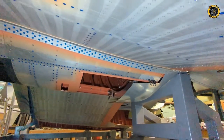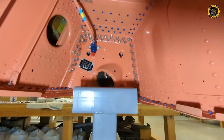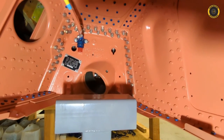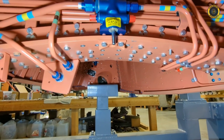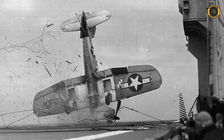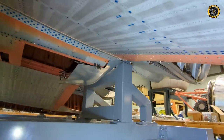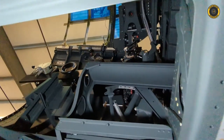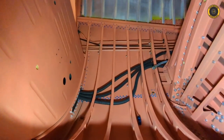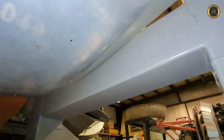Now we're underneath the Corsair. There's the center section of the fuselage and here's the bent wing part — the bent wing bird as the Corsair is known. There's your main landing gear mount with that intricate angle-swiveling mechanism that gives the Corsair its short, stout landing gear for carrier operations by bending the wing like this. Intricate design — they were able to build a gear stout enough to handle carrier operations while clearing the some 13-foot diameter propeller. Looking up into the cockpit from underneath, just forward of the cockpit is the fuel bay — about 230 gallons or so of fuel in a rubber bladder cell mounted right here. Then just forward of that is the firewall and the engine. So: engine, fuel, pilot.